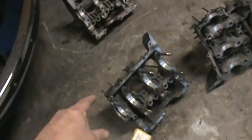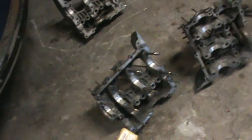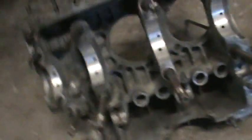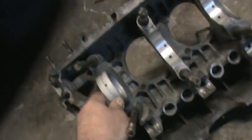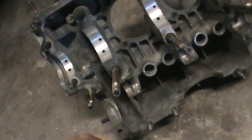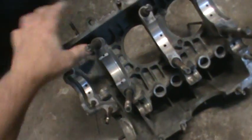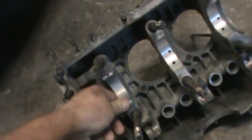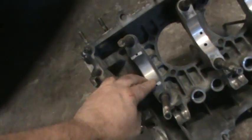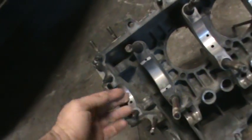Here's the motor we took to South Carolina that ate the rear thrust bearing — I got that fixed. I bored it out and stuff, but for some reason the front bearing didn't want to fit really well. I talked to JC about it and I had another motor they did that was the same way. So instead of using that bearing there, I'm going to use the two-piece bearings in the front because they fit really nice.